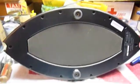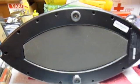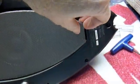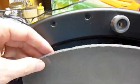After you do this, you're going to end up prying along this edge, and you're going to be terribly frustrated trying to figure out how come you can't open the thing up — because there are two hidden supports. The hidden supports are underneath the grill. Yours won't come off quite this easily; I had to get underneath one corner with an ice pick and then use a screwdriver to get it all loose.